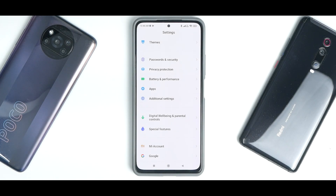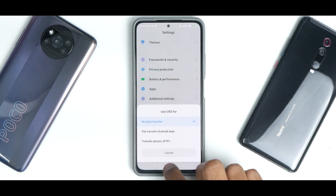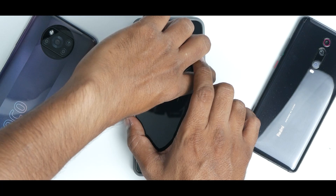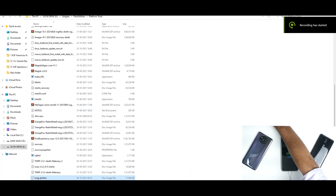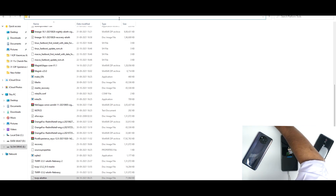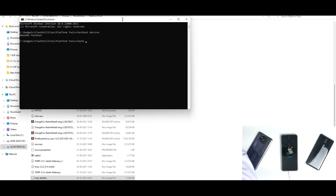Once you've taken care of all of that, boot into TWRP and then flash the ROM. Connect the phone to the computer using a USB cable. Press and hold the power button, click Reboot, then hold Volume Down and Power to boot into Fastboot mode. Now, right-click on the TWRP file, copy its name, open the address bar, type CMD and hit Enter. Type 'fastboot devices' to verify the device is detected. Then type 'fastboot boot' followed by right-clicking to paste the file name with the .img extension and hit Enter.